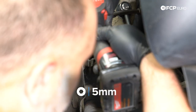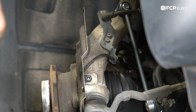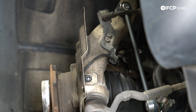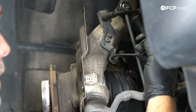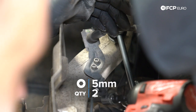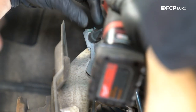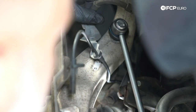There's a 5mm screw that holds the ABS wheel speed sensor in place — go ahead and remove that. I'm choosing to remove the wheel speed sensor because when we pull the bearing it's possible to catch it, and I'd prefer not to break it. It came right out, so we'll hang that off to the side. Now that the wheel speed sensor is out, we're going to remove the upper bracket as well, because it blocks one of the wheel hub mounting bolts. Same 5mm Allen — that'll allow us a little extra room to work with.